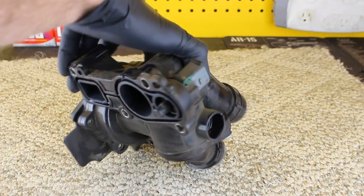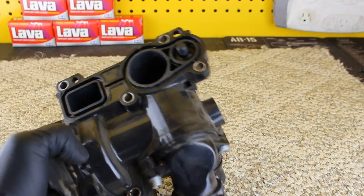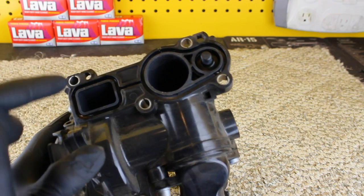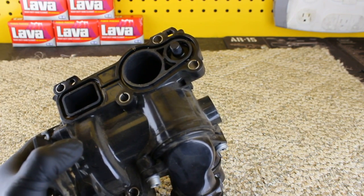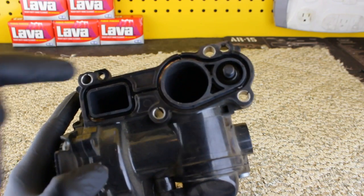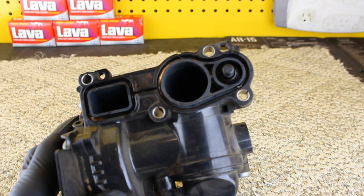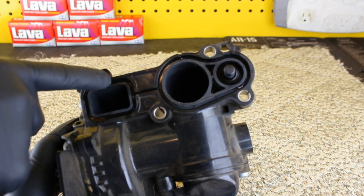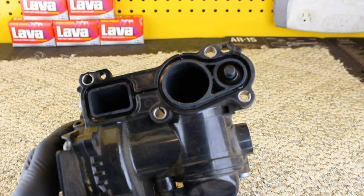If we rotate the pump around — and this one's actually missing the gasket, it wasn't missing the gasket when I replaced it — you can see this track right here, that's where the gasket goes for where it bolts to the block. What usually happens is they get a little distressed right here, right next to the alignment pin, and this plastic will crack. I've also seen oil leak on them and swell the gasket, and that'll cause them to leak. Leaks are definitely the most common reason for failure on this particular part, generally right in these two spots where you'll see plastic deteriorate or a seal expand due to oil.